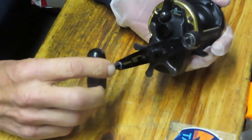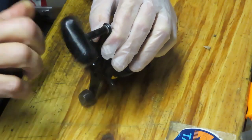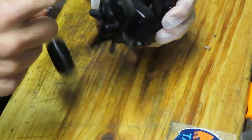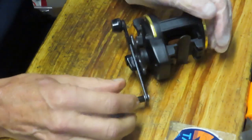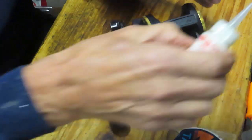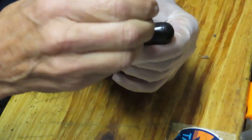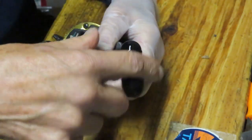It's kind of almost like grinding your teeth - it comes right up through the handle here. And it may actually be the handle. You know what? It is the handle knob. So it says four ball bearings - it wouldn't surprise me if one of those ball bearings is in the handle here. We'll just throw some oil on there, see if we can't quiet that up. There's an oil port here - we'll go ahead and put some in there as well.